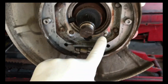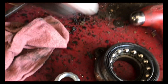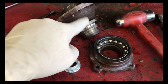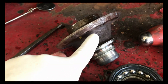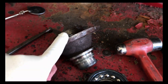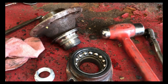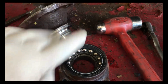After I took the four bolts loose from the backside, this basically fell out. So what I plan to do — the hub, you have to buy the hub separate from the bearing. I'm going to go ahead and cut this race off, then press the new bearing onto the old hub and reassemble it as one piece, so I won't have to worry about trying to press this on with it on the car. It should work fine. I don't know why this doesn't come together like they do on General Motors, Chevrolet trucks and GMC trucks — it's all one piece there.